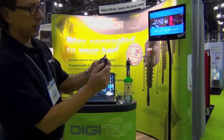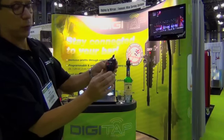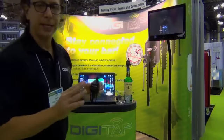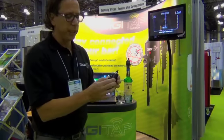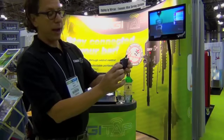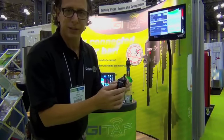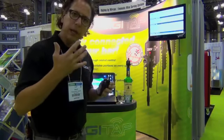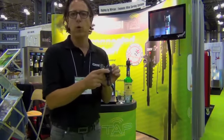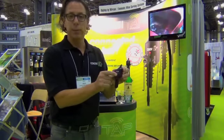Every tap has selectable portion control. Each switch position can be programmed to anything you want. So for example, you don't necessarily need to have a one ounce, two ounce, three ounce — this could be a quarter ounce, two and a half ounce, or 3.45 ounces. In more common use, you might have a high end Macallan's with only a one and a quarter ounce pour in position one, and then the other two may be blank.